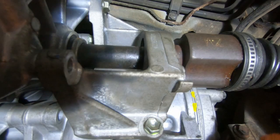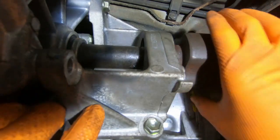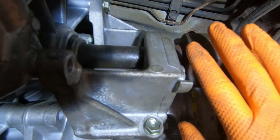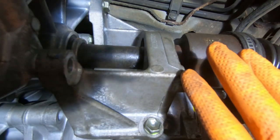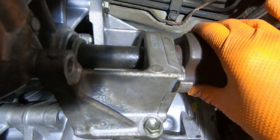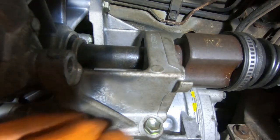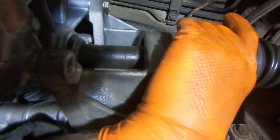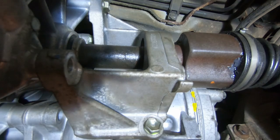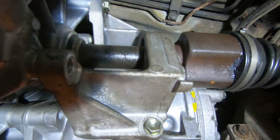After all the efforts to build all this out and put it all back together, we've hit a bit of a snag. With the shaft in place and pushed into the drive, the right-hand side is fine, it's clicked in properly and it's good and secure. I've got a bit of a problem with this left-hand side though, and that when we try and turn it, you can probably hear that, it's not actually mating with the gears inside the box.